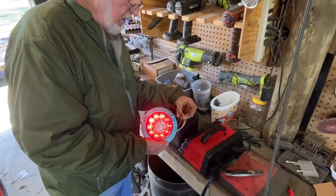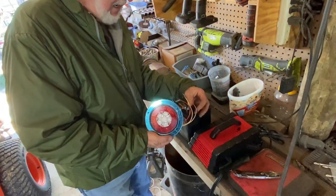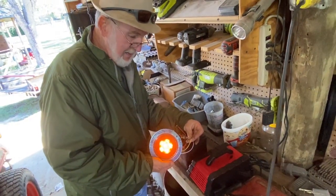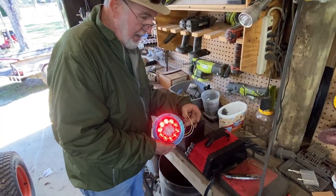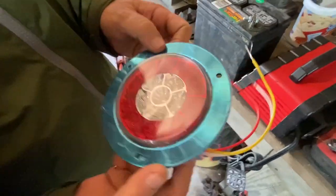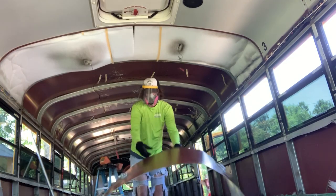One of the things that made us really go down this path is because I wanted, when we go back with new wire, to hook to LED light fixtures. That's blinkers, reverse lights, marker lights, cabin lights, stairbox lights — all the lights in here. I wanted to be LED for the sake of efficiency and for a modern, cool look. Since we're gutting all the fixtures anyway and may not be putting them back in the same places, it just made sense to tear out all the wire.